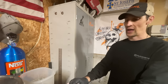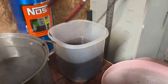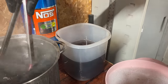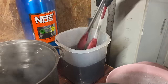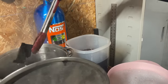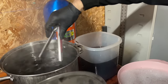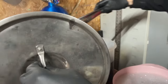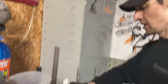There's also a heat shield for the fuel tank. Shocking in cold water is important — you could keep parts in the dye bath for half an hour or an hour but they only take so much dye. When you put them back in after the cold water shock, they will take more dye. I've left them in overnight, I've left them in the boiling dye bath for 45 minutes — moving them in and out of cold water is actually faster.